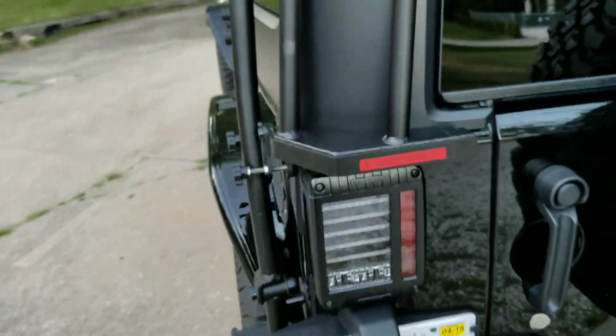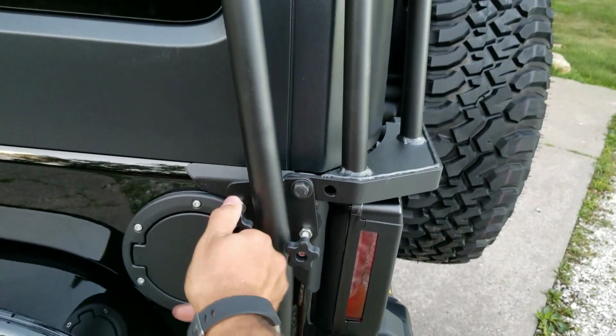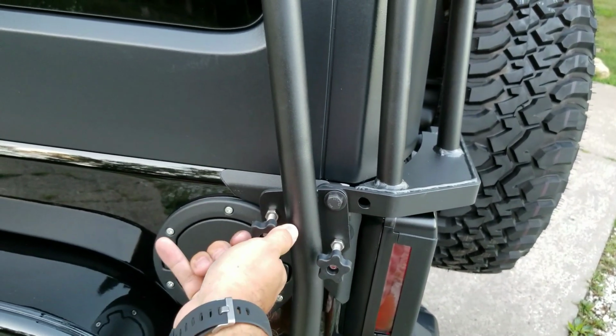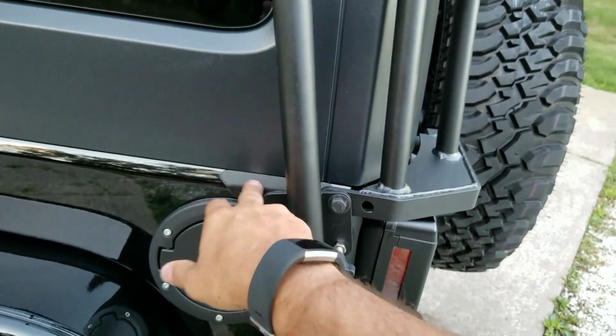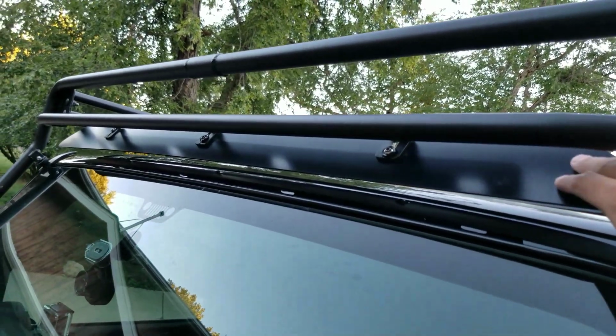Okay, so once that's all done, then you can tighten your isolator handles here, push those against that wear plate. Just push them, turn them so they're nice and snug against there. That's going to help push that wear plate in as well. After that's all said and done, you can install your wind deflector. That's super easy, no tips or tricks for that one.